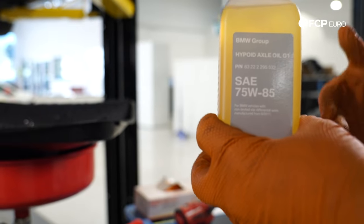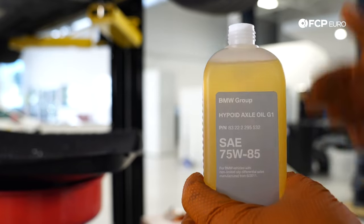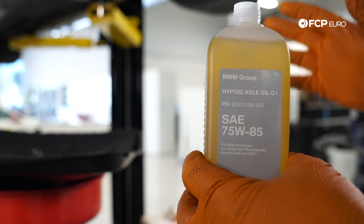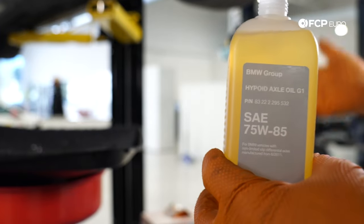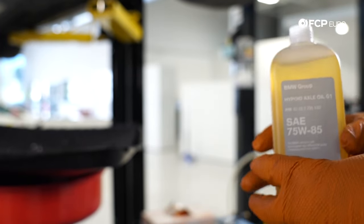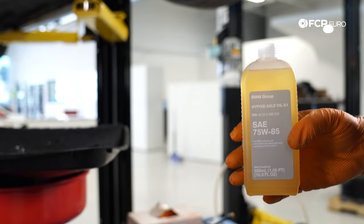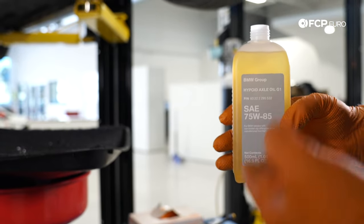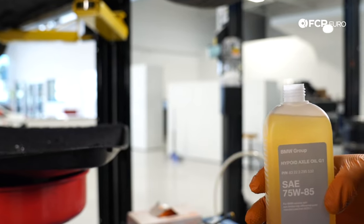Another thing to note is that on these diffs they are pretty small, at least on this 328. Fluid fills will be anywhere between one to 1.2 liters — it really depends how much you extract. We have 1.5 liters, three bottles. Realistically speaking, even though BMW does not have a service interval on these differentials, I'd say 50,000 miles is probably the best time to do this. All you're doing is removing the old gear oil and putting new gear oil in — the stuff does oxidize and the additives wear out over time. So to ensure long service life of the diff and prevent any possible problems down the road, putting new fluid in is never going to hurt, even if there is no service interval.